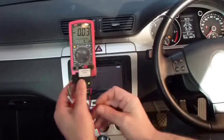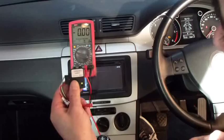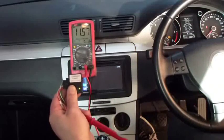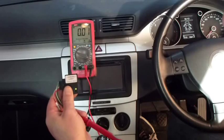All we need to do now is decide what output we want. At the moment it is set as a default as an ignition. We have the ignition on. We connect the multimeters and we see we have 12 volts there. Pin the ignition off and we go to zero.